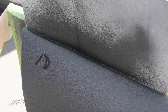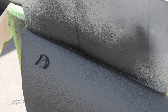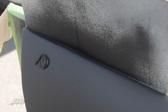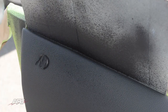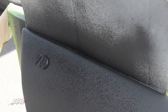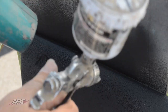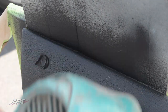Many techs have been looking for that holy grail of a spray texture that they can purchase. I would suggest that it cannot be simply purchased. It must be created. The aerosol solvent textures typically give you one choice of spray. They must be sprayed from 18 to 24 inches away to be truly effective. They remain soft for days. Come back the next day and you'll find they've laid down and left a shiny spot. They're very expensive too, but to me, they are all garbage.